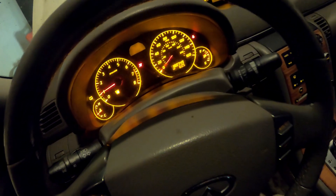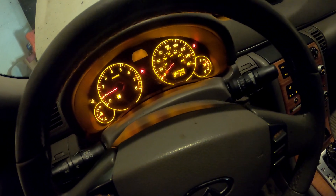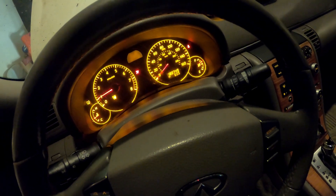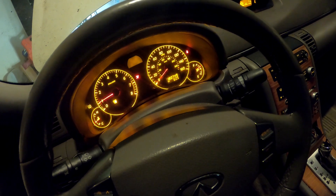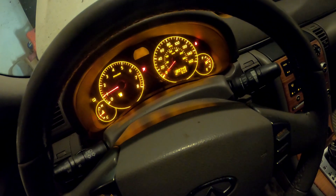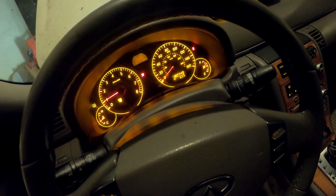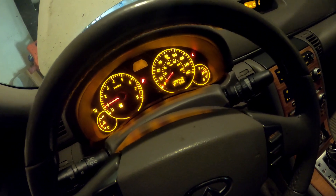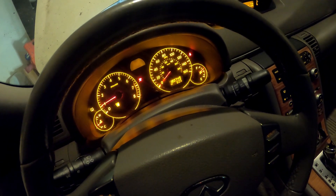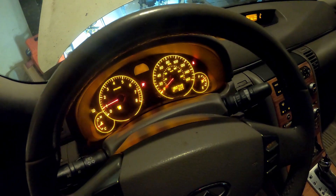Pretty much, it was the fans that were causing this car to overheat — at least this time it was the fans. After about an hour playing around and looking at the fans and bleeding this thing over and over, because these G35s, these Infinitis, are notorious for needing to be bled the right way to get all that air out of the cooling system.